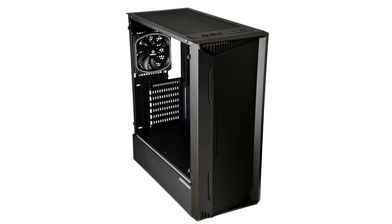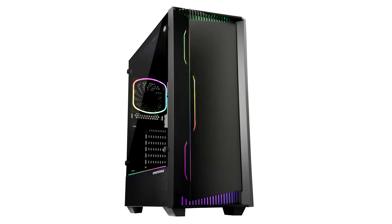Liblusion LL30 has efficient space for high-end components and advanced cooling. It offers three designated mounting places for AIO liquid coolers, supporting radiators from 120mm to 360mm depending on the position. The removable HDD cage provides extra space for PSU with longer chassis, and users can easily access the installed PSU via the detached PSU side cover.